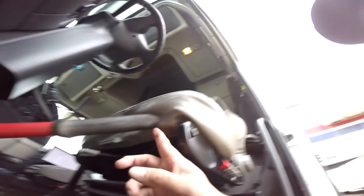Alrighty guys, we are doing a pre-trip inspection here at the yard, and I wanted to show you guys something. My truck does not have a spike — as you can see right here, there's no spike — and what that means is there's nothing to pull down for the trailer brakes. So what I do to check my brake lights is I use this bolt cutter here, and I put it right here on the brakes so it goes right against my seat, and then I go check my brake lights.